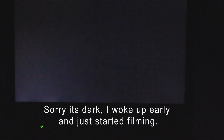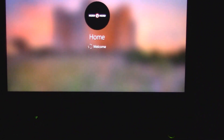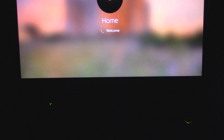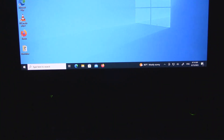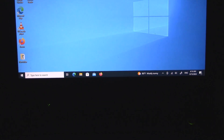All right guys, this is the next day — we're going to boot it up for the first time. I push the button and let's see if it holds the date from last night after I was done, and if it boots without giving us that error. Looks like the CMOS battery is working — we have a login. We are no longer getting the date error and the date is correct. Thank you again for joining, thank you for watching another video, and have a wonderful day.